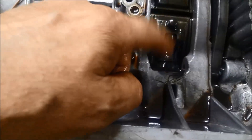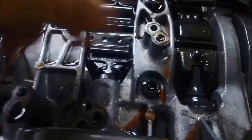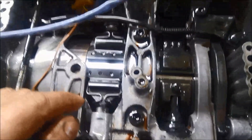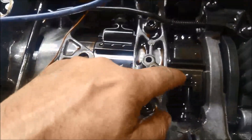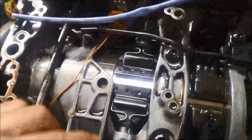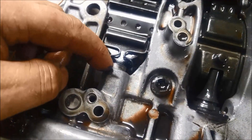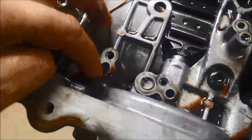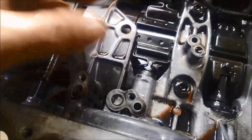What you can also do is readjust these bands — there are shims on these. You've got to remove the valve body to adjust them; you just slide that off. They have selective shims that tuck in there to set the end float or stroke. I like to put them at about three mil stroke. While you've got it out, you can see how far the piston travels. Apply your air pressure in here and see how much movement there is to lock it up.